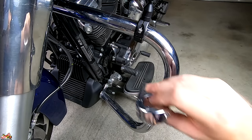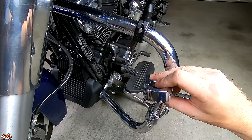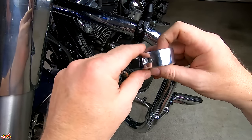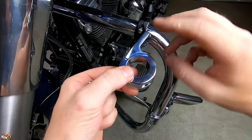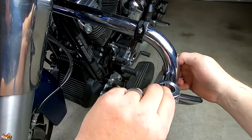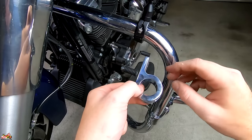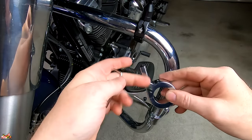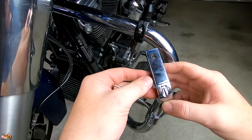First, take out your clamps and find a location where you want to install. The clamps come with four 3mm Allen head screws, two 2.5mm Allen set screws, and some hex wrenches, so it's really simple. All you have to do is take out these two screws, the clamp comes apart, you put it around your engine guard, and once you're happy with the position, you tighten it down, then put the set screw in. All the parts come with the kit.